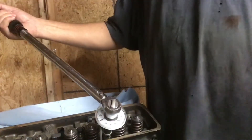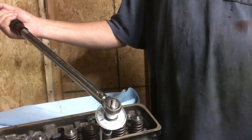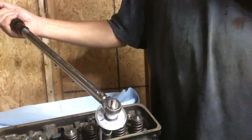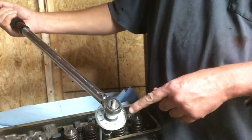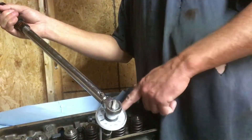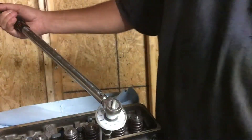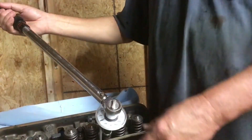All right, I'm now about to tighten down in the final pass on all the head bolts on the passenger side of this 4.3 liter V6. To do this you need what's called an angle torque gauge — it's a half-inch drive and it just fits between your torque wrench and a socket. I've got a little bit of extension on it to get down there.